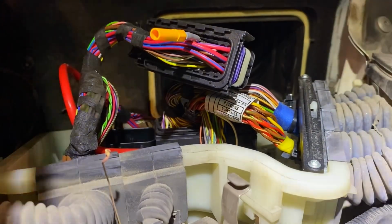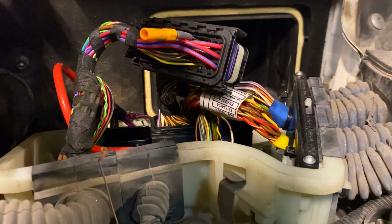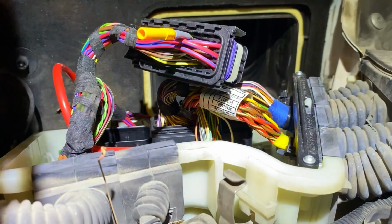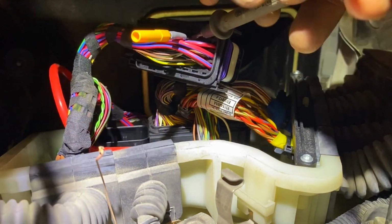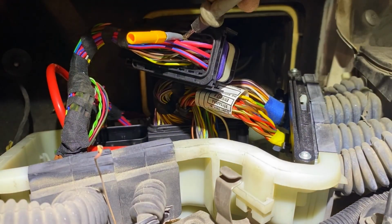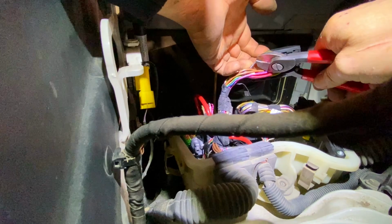Always remember, back probe, because if you front probe them, you'll damage them, especially those LIN connectors. You'll damage the pins, then you'll get open circuit fault codes, and it's a big disaster, so just back probe them. I'm only doing what you saw just shortly, continuity testing it, but I'm just showing you a better camera angle of exactly what I did. And yeah, again, it failed.